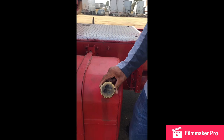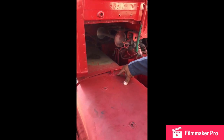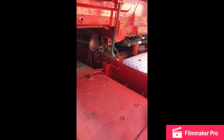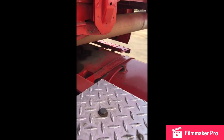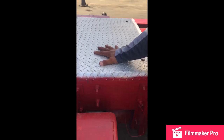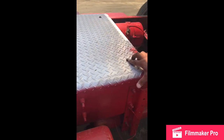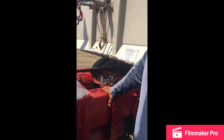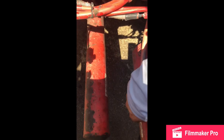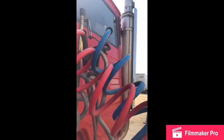My gas line: no cracks, no breaks, no bends, no leaks, securely mounted with a clamp, mounted and secure. My gas tank wires: no cracks, no breaks, good condition, no illegal tape, not too loose, not hanging, mounted and secure. My catwalk: no cracks, no breaks, no oil, no grease, no illegal welds, always in straight position, securely mounted to the frame with nuts and bolts, mounted and secure. My frame: no cracks, no breaks, no holes, no illegal welds, always in the straight position, mounted and secure. My drive shaft: no cracks, no breaks, no illegal welds, always in the straight position, joints are always greasy, mounted and secure. My exhaust: no cracks, no breaks, no holes, no illegal welds, no rust, securely mounted with straps, mounted and secure.